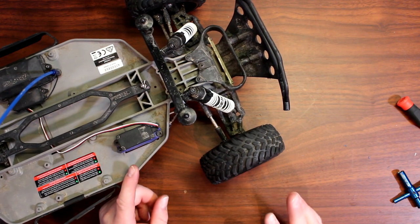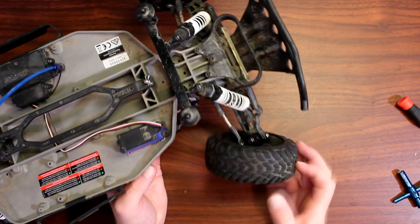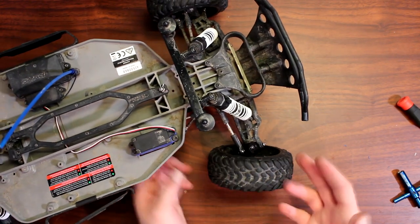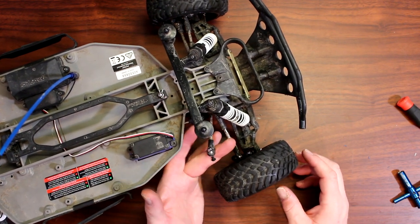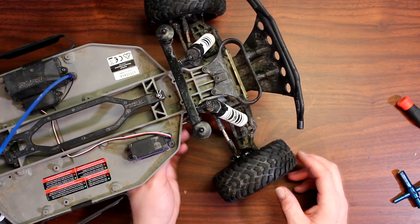On the 4x4 it's a little bit different, but basically when you see your steering is floppy, it means your steering block is broken. You'll have your wheel flopping and this piece here that's part of your steering will basically be doing nothing.